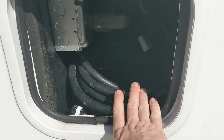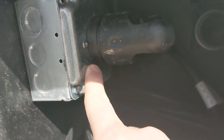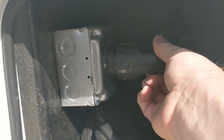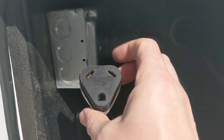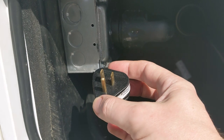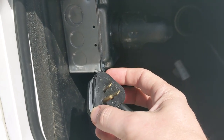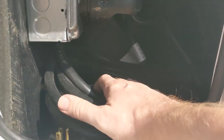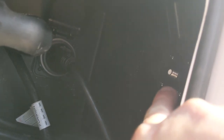Over in this compartment is the shoreline power connector. Normally you would plug it into the vehicle if you're docked at a campsite — it connects to a 30-amp circuit. There's also an adapter for a regular 15-20-amp outlet. Just be aware that if you're using this adapter, you're probably not going to be able to use the microwave or the air conditioner — there are limitations when using a standard household-style circuit. Also in here is a coax connection, so if you're parked at a campsite with cable TV access, you can connect a TV inside.